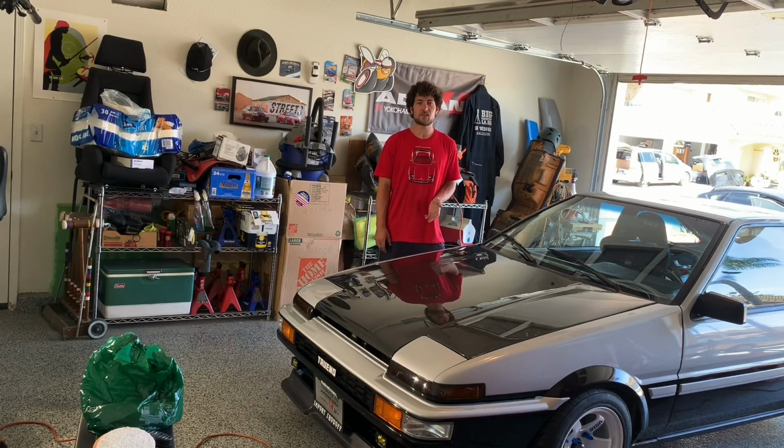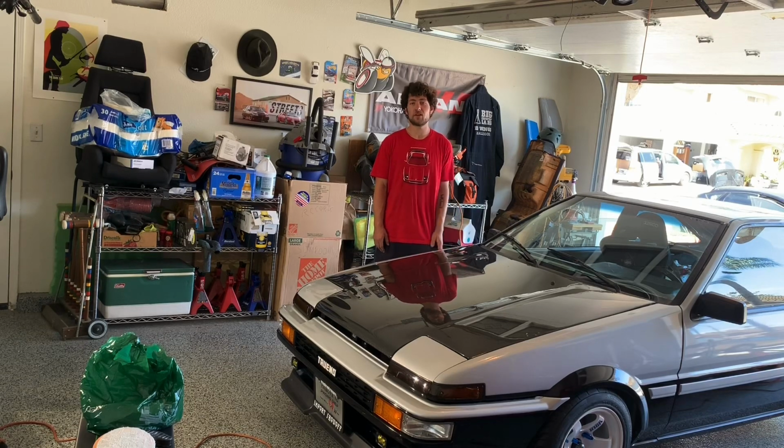So with Teslas, sometimes you might get one that looks good, sometimes you're gonna get one that looks like somebody just sanded it and didn't bother to polish it afterwards, or they compounded it with a rotary polisher and then didn't finish it out. So even if you think that your car is new and it doesn't need paint correction, 90% of the time I'm gonna tell you it does.